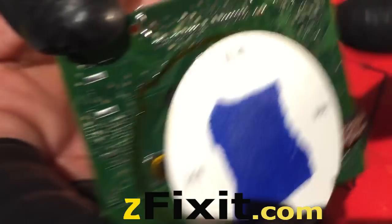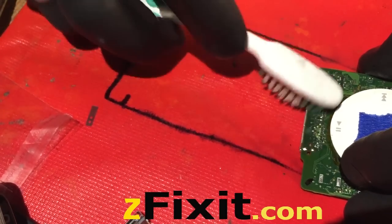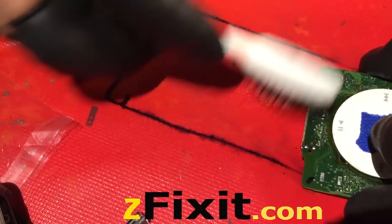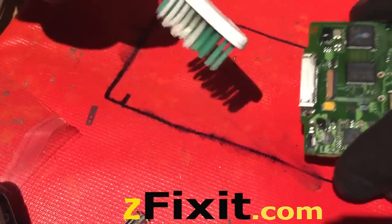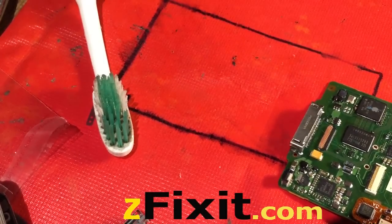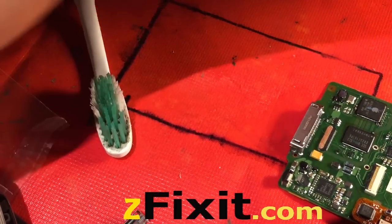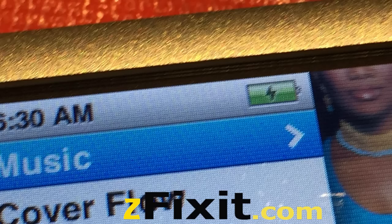There's the rear side — clean it up. There's probably still some flux residue underneath the charge port, but it will not corrode or eat through any of the metal. The problem with this iPod was syncing, not charging — but after everything was assembled, I wanted to show it charging. After doing the repair, we plugged it in and the computer recognized it instantly. All pins were good.